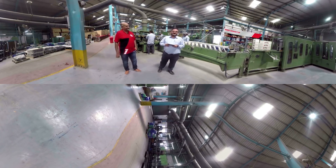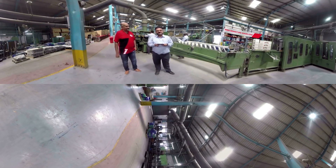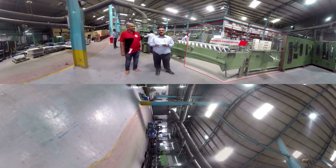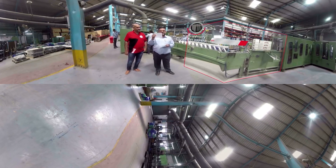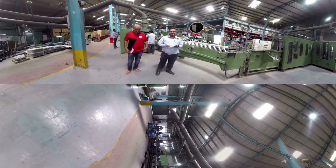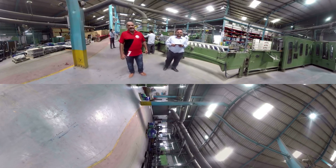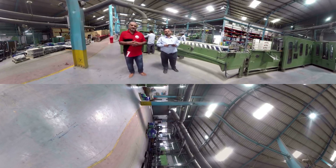The first process of assembly is enveloping. In enveloping we use a specially synthesized PE separator. Following this, the next operation is stacking, where the positive and negative plates are stacked and high density glass is used in the middle. Because of this process, Livgard batteries give high density current, super-long life, and strong performance to run on all types of rough and tough roads.